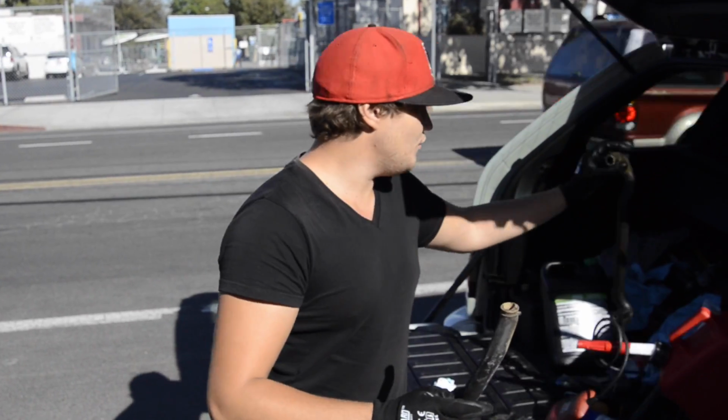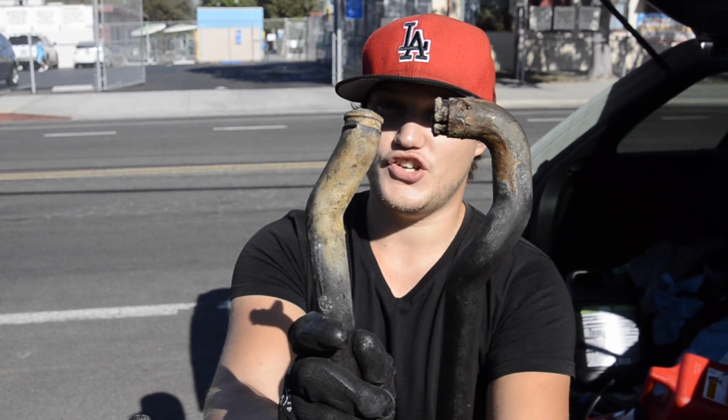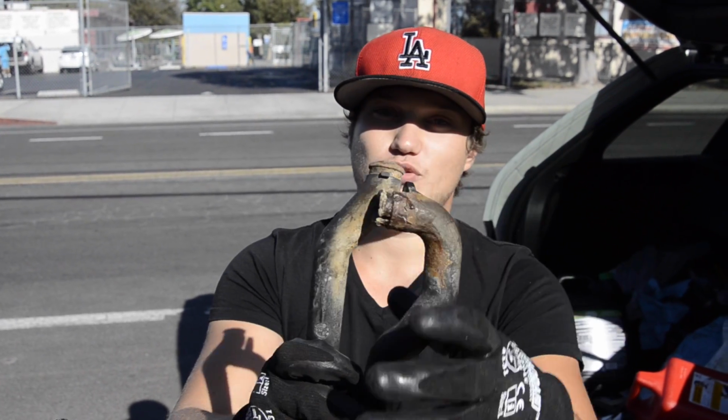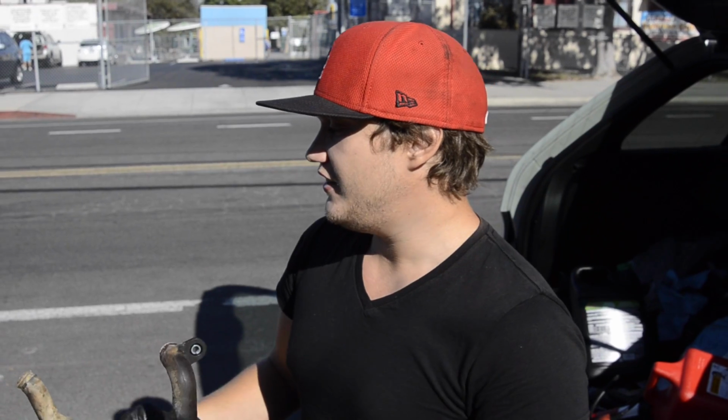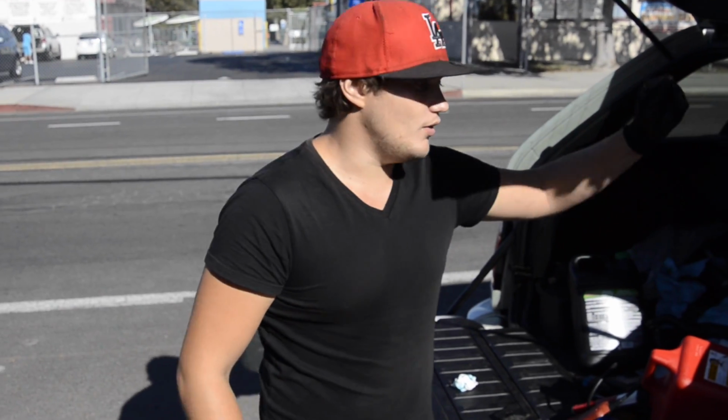these two transfer pipes. Looks good. You see that? All this stuff. Yeah, of course it's worn out, but when it overheated, then it was gone and everything leaked out. So we already replaced this part. And now we're gonna replace the water pump, thermostat, both radiator hoses, and the coolant temperature switch. So let's get to it.